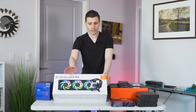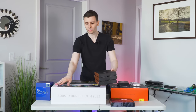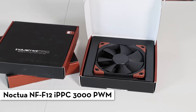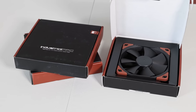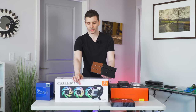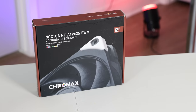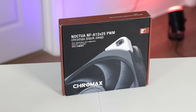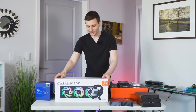I'm probably not going to need push-pull in my opinion, so what I'm doing instead is replacing the built-in fans. I'll repurpose the RGB fans that came with it and got three industrial Noctua fans — the fastest ones they have. They're loud as hell, but they have super strong static pressure, so they'll more than make up for the lack of push-pull through the radiator. For the back of the case I have a regular Noctua Chromax — not industrial, so a bit quieter. I like to keep my apartment temperature higher than most people, so I need better cooling.